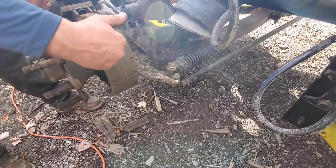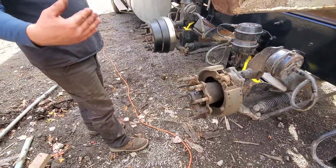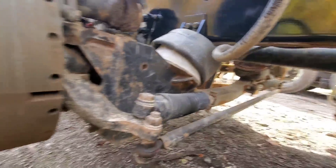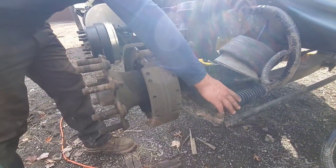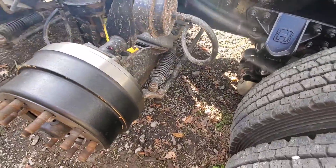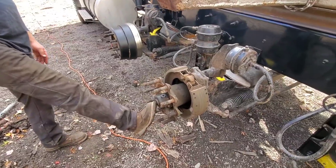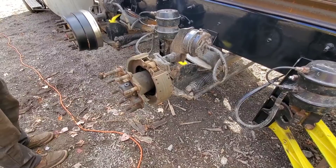As the front of the truck turns, you can leave the steerable axles down, which saves on wear and tear on the frame. As you drive, these stay down and they curve with you. Joe notices the drag link — the tie rods. Jesse calls it a steerable, and explains that without the drag link it'd be hard to go around corners. His other truck had non-steerables, and that was part of the reason he got in an accident — he had to lift them to go around curves. With these, you can leave them down, at least the majority of them. It works with air pressure — there's a switch in the cab; you pull the lever and they lift up.